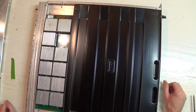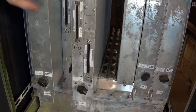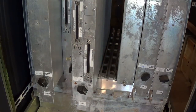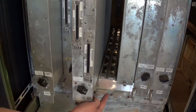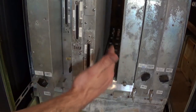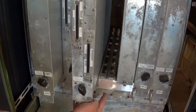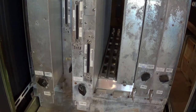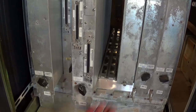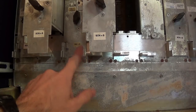Last thing — we can take a look at putting these boards back in, because that has its own challenges. I'm returning the processor board and memory board to the cage. The air comes up through the boards and is exhausted out the top. There are little flipper diddles latched up on two boards and down on others. This is a blanking slot and I don't have a blanking plate for it right now. On the inside you can just see a weighted flap that opens up. When there's no board present, this flap is held down so the air is concentrated through the slots that have boards in them. Very clever — however, it makes inserting boards kind of a pain.